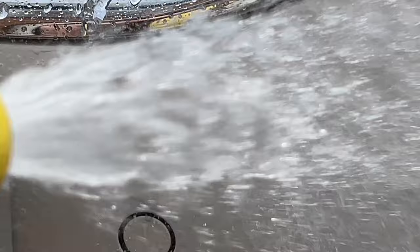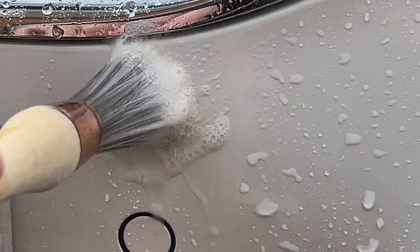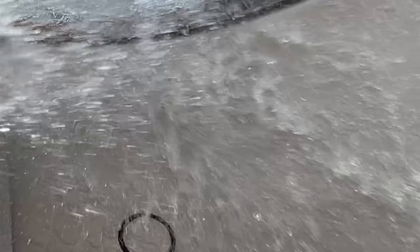Let's try another hit of Surface HD — that hasn't dislodged it either, but take a look at the water behaviour from both products: it still hasn't affected the Alpha Wax applied last week. Let's try another hit with the Auto Glanz Bug Off, and this time there may be a need to agitate it. I'm using a soft-tipped brush, only using the top bristles to gently persuade the insect body away from the bumper. This certainly had the desired effect — but working in such a strong chemical, will it have made a difference to the wax underneath?